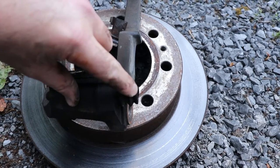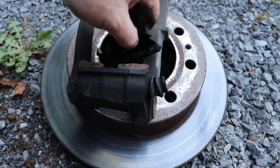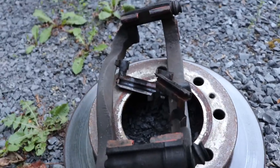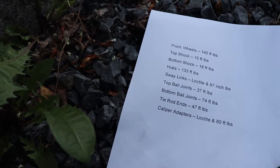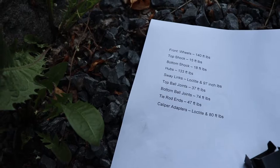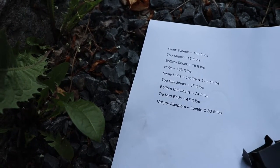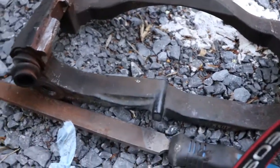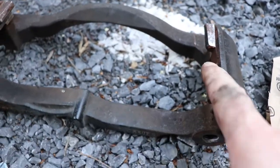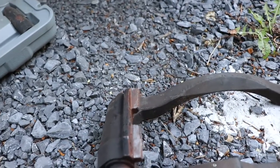At this point you want to make sure this is all nice and clean — go over it with a wire brush and some brake cleaner. I've got some copper anti-seize on here since this has been apart a few times. You'll get new clips with your brake kit — just pull these off. Make sure that the metal isn't all swollen because the pads need to slide on there freely. If the pads are tight they'll get hot and seize up. Clean these cavities and put the Silglide in there.